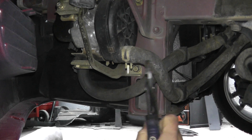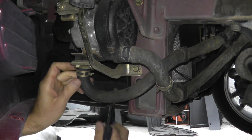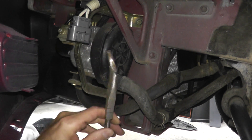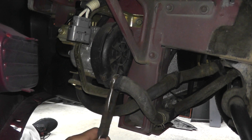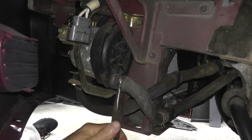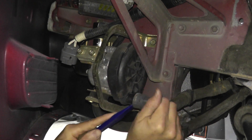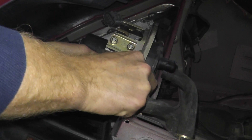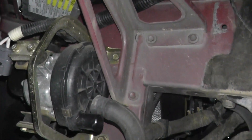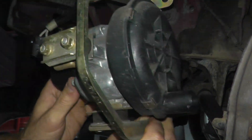To remove the air pump we have two air lines — one right here and another one running through the bottom. These lines can be really hard to remove simply because it's been on here for twenty-one years. These are pliers made specifically to loosen up hoses and will save you quite a bit of time. A trim removal tool set is also useful. Then we have two 12mm fasteners and we can take the pump right from the vehicle — here's our air pump.